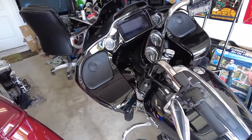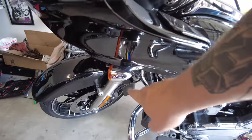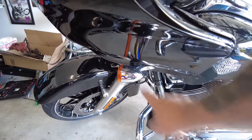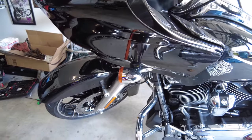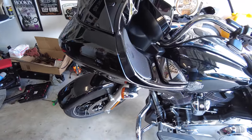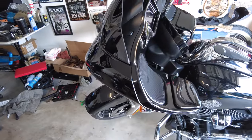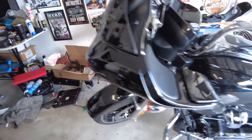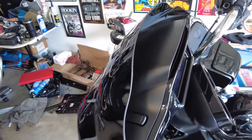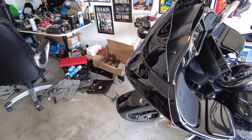What we're going to do is take the windshield off. One more bolt — this one on each side comes out too. This goes through the turn signal into the fairing, and then this is bolted onto that. So those turn signals are going to come away with the fairing cap. They plug in up here under this. So the procedure: take out the windshield screws. Then after the windshield comes off, you grab this vent and it just goes pop — it's on with some clips. Don't be afraid, pull straight up, it's going to come off, no big deal.